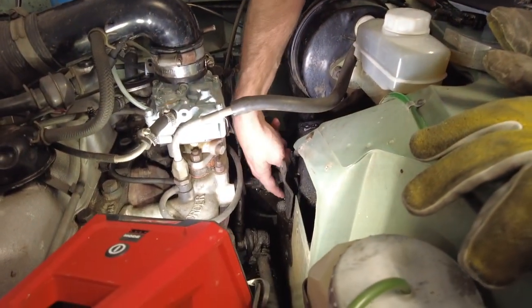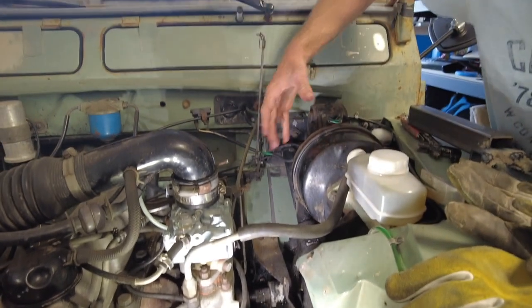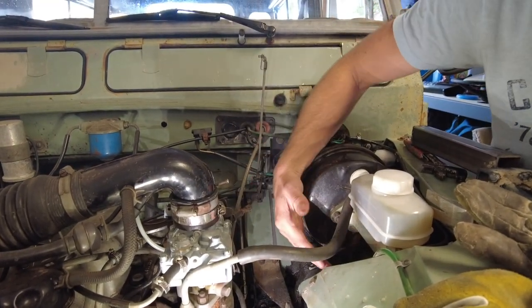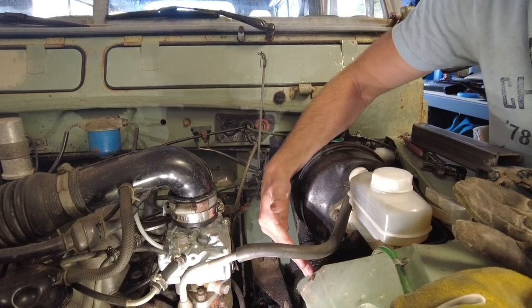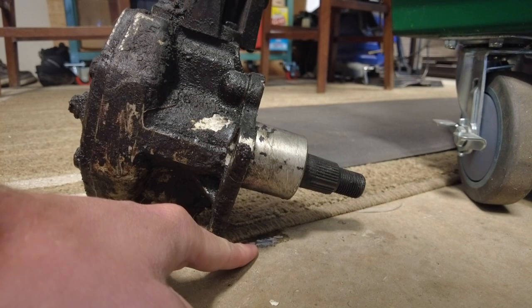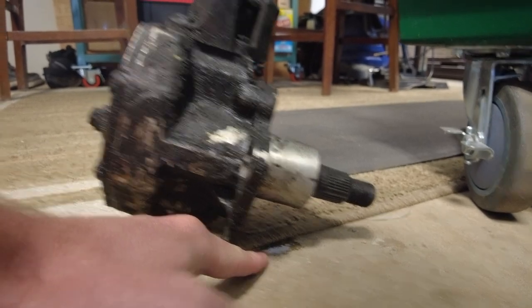We're going to pull off the bolts right here, and then loosen the bolts up here to get the steering column out. And we dropped the whole steering box through the front driver's side wheel well. We've got the old one out — you can see it's still leaking oil. This thing is a big giant mess, so I'm glad we just have a brand new one.